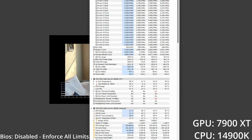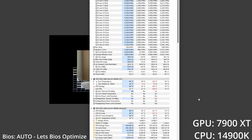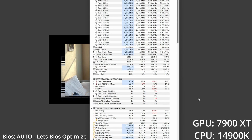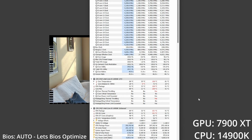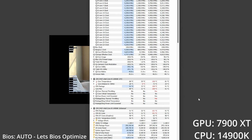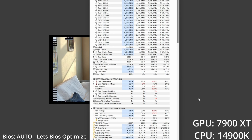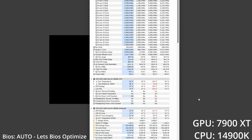Now the question is: what do we get when we disable this BIOS setting and rerun the exact same test? Here are the truly off-the-shelf default settings — set to 'Auto, Let BIOS Optimize.' As you can see, our core temperature is at 100°C, our CPU package is at 100°C, core max is at 100°C, and the CPU package is at 101°C. Our maximum CPU package power is 307 watts — a massive uplift over the previous 253 watts. Averaging about 254 watts in CPU package power, the CPU package temperature averages 91°C, and the core temperature averages 81°C.